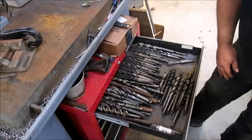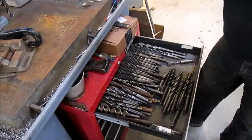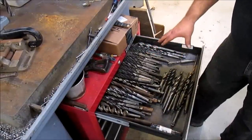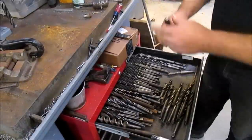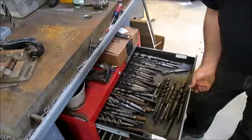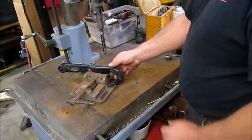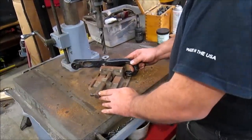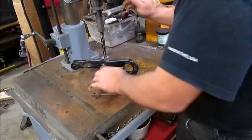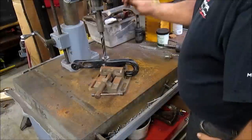We got a bunch of 2-flute, 4-flute, we're doing some 6-flute bits in here. Very few of them are pointed drills. Most of them are like this, so you have to have a pilot hole, but these drill a wonderful hole. Got the 41/64 set up in here. That's what it calls for a 3/4 10 bolt. This will self-center somewhat, so got it in place.